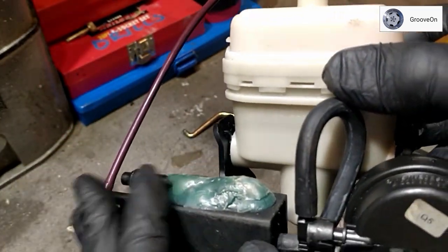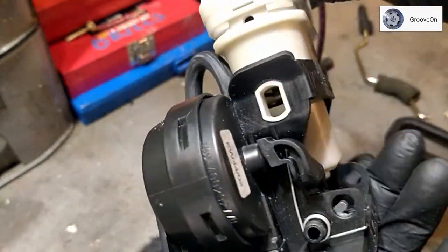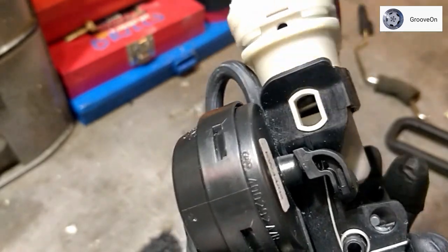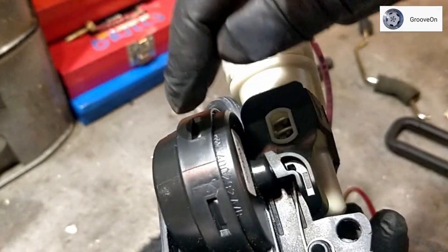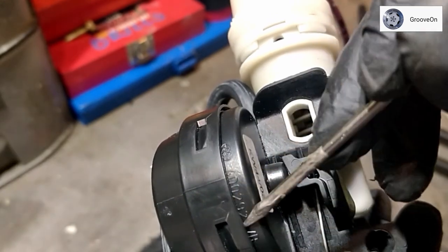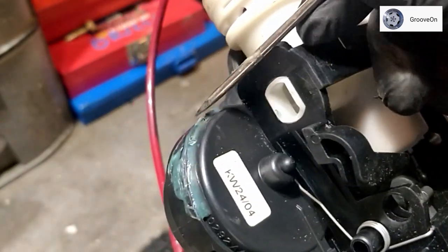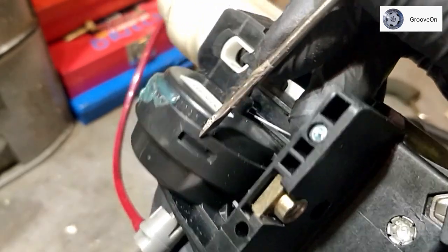Moving over to this little round device, this is also very typical for leaks. If you look closely, you can see it's starting to split on that one, and splitting there too. Once these become loose it loses air from the actuator. I've seen people seal them all the way around. On this other unit you can see I had that issue and sealed it in that spot. I wouldn't necessarily recommend taking it off as you'll likely snap more plastic — just seal the areas where you see leaks.